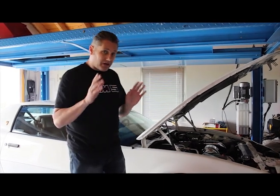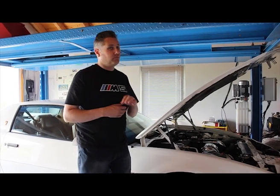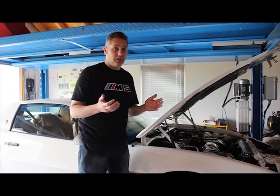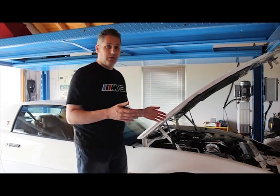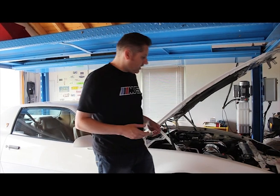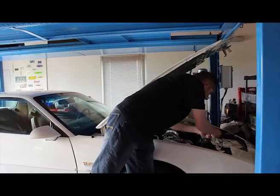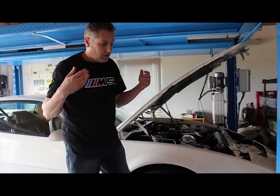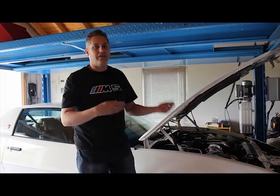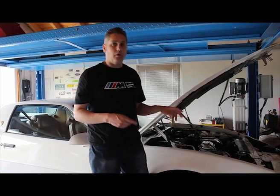In today's case, I've been charging for about an hour at 10 amps — 10 amps is the bare minimum you need to use with a deeply depleted battery like this. I just checked it with my multimeter and I've got about 11 volts now, so we went from 4 volts to 11 volts in just over an hour by hooking two batteries together.